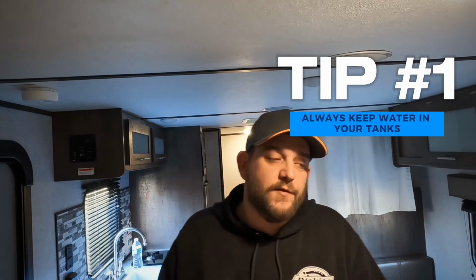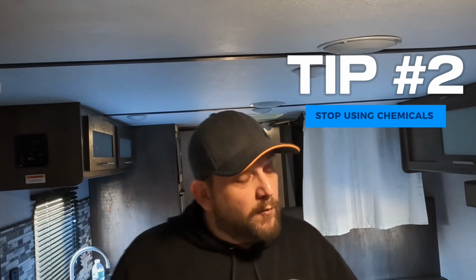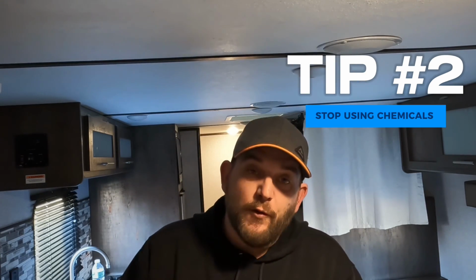Alright guys, number one, always keep water in your tanks. I can't stress this enough. You're going to hear me repeat it throughout the video. Water is really going to be the best weapon here when it comes to keeping these systems working best. Even when we're traveling down the road, I put 5 gallons in when I'm done pumping out the black tank and a couple gallons in the gray tank. It really just helps everything slosh around on the travel ride back home, keeps stuff from sticking to the side of your tank and stuff like that. So really the only time you shouldn't have any water in your tanks is if you're winterized and the camper's parked up.